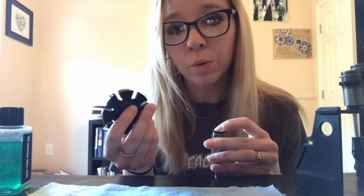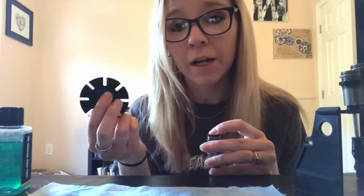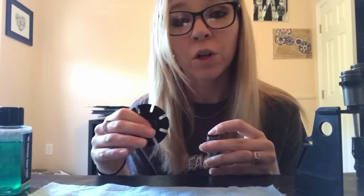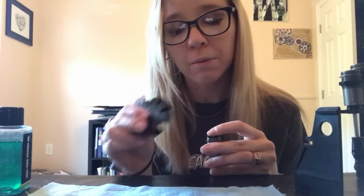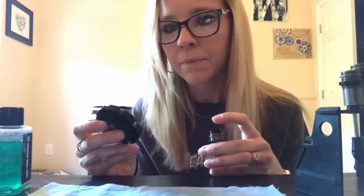So what this tool does is it allows me to be consistent when I'm building my shocks. You can also use this tool as a tuning tool though, because if your car is feeling a little bit too bouncy and maybe you set your rebound at say 6mm like I'm about to now, then maybe you want to drop down and try to eliminate some rebound to make your car less bouncy. So you would try 5mm or 4mm or 3mm. So this tool can be used as a testing / tuning tool too. Something definitely cool to try on a test day.